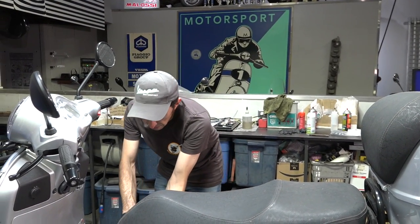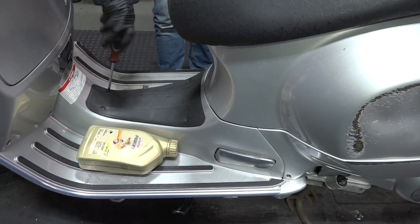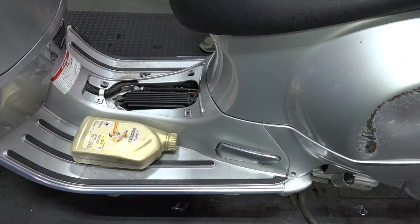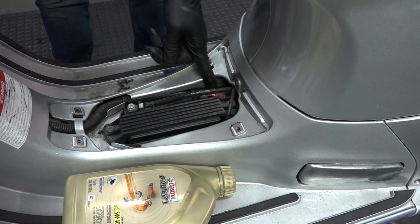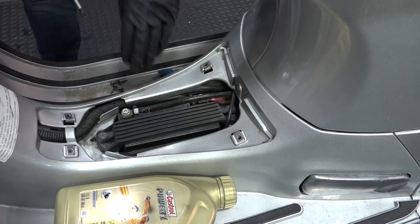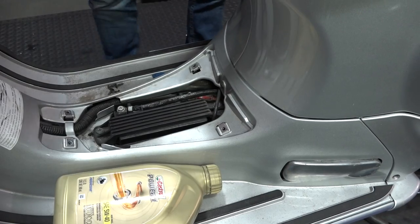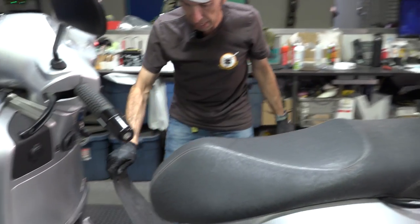One other check — I want to see the health of the battery. This has a fairly new battery. Like the drive belt, if you're doing a long trip it's sometimes best to start fresh. If you have a three-year-old battery that might go five years, it may just be a good idea to change it regardless — same with the drive belt. Say you have 5,000 miles on the belt and you're going to do a cross-country trek; I'd suggest just changing it. I know this battery is good — it cranks over the scooter well. We have specific capacity testers. Make sure the battery isn't too loose, the clamp needs to hold it in place. It cranks really strong and the battery is pretty new, so I feel set up for success.